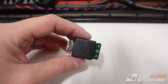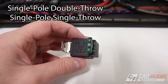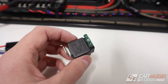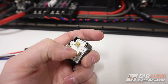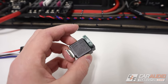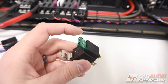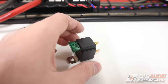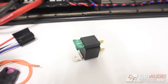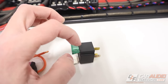What kind of relay should you get? Typically you'll want either a single-pole double-throw or a single-pole single-throw type relay — the acronyms being SPDT or SPST. For this application, we don't need a double-throw, but if that's what you have, you're just not going to use one of the terminals. Another feature to look out for are relays that have a fuse built into them. You always want to protect the wiring so that if you draw too much current through the relay, it blows the fuse before anything more dangerous happens. An inline-style fuse works too, but having it built in is cleaner.